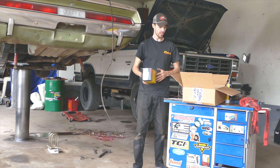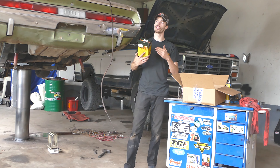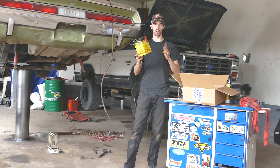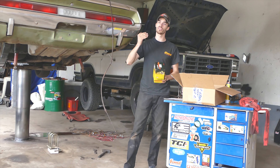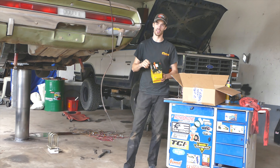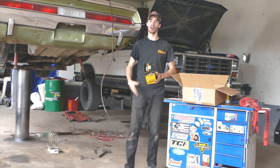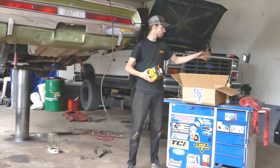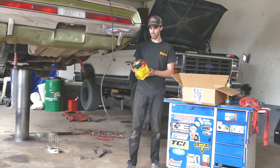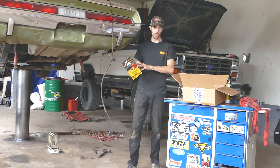We finally got parts for the Challenger — suspension parts, brake lines, gaskets. I also chased out the yoke for the driveshaft, so we have a shorter driveshaft by one inch, because with the 8.75 rear end it's approximately one to one and a quarter inch longer in the third member itself. So it pushes the driveshaft closer to the transmission, and I was pretty much bottoming out on the tail of the transmission on the slant six setup. We now have about one to one and a half inches of play that the yoke can go in and out. I also ground down the whole suspension — leaf springs, leaf spring hangers, perches, and all that — so it's all nice and painted black. And I went ahead and bought an Energy Suspension kit from Rock Auto for about 50 bucks, which gets you all the bushings and hardware needed to go from rubber bushings over to polyurethane bushings.